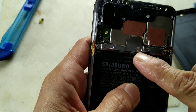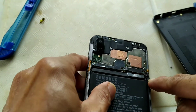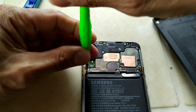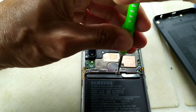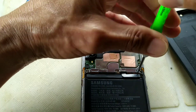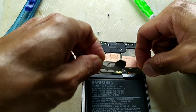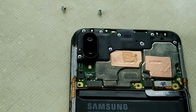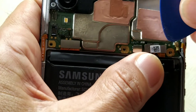Now we need to remove all the screws from the battery and the logic board, removing them one by one. I can still feel the vibration because the battery is still on. Remove the cover plate and set it aside — this is the battery connector. The battery is now removed, so no more boot looping.